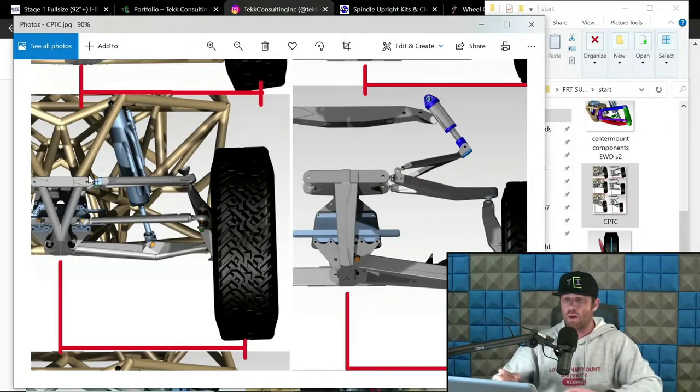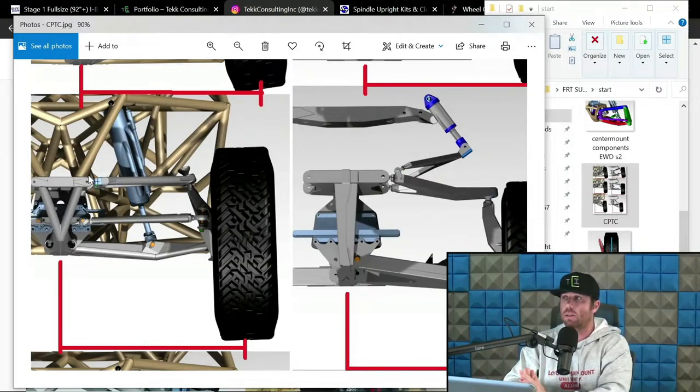ride height, etc. Now, ride heights, I like to see a degree to a degree and a half, maybe 2 degrees on the high side of negative camber at ride height for trucks in this fashion. Just to be crystal clear, I'm not referring to beams. So with trophy trucks and some like class one buggies, I like to see between 1 and 2. We have had clients request other numbers and we set them up accordingly, whether that's like a half degree at ride height or like 2.5 at ride height.